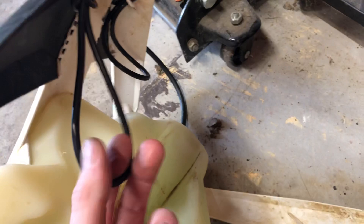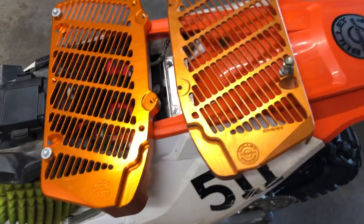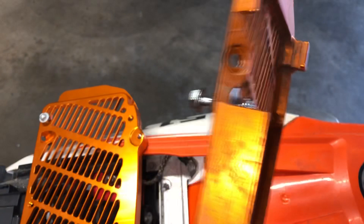Bulletproof has these little rubber cords — rubber loops — that you can loop through your shroud hole and then hook onto here. I tested it out and it works pretty well, at least as well as my zip tie method did. However, I didn't have something like that for the older style, and they don't have pre-drilled pre-threaded holes on the older ones, so I just took a bolt and made my own, making sure they don't hit my fender or the radiator on either side. That works well.